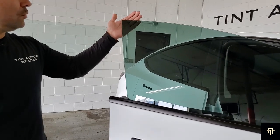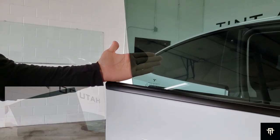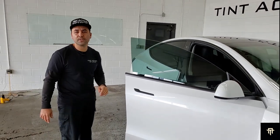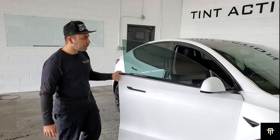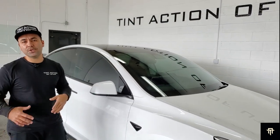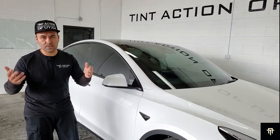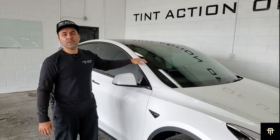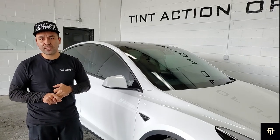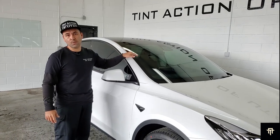Your windows don't have a frame, which means you could actually shave the window tint, giving your windows a factory look. You don't want to have a gap, especially when you have no frame on your glass — so make sure the shop you get it done at can do this for you. The front windshield, we did 70% ceramic. It's not very dark, but it's going to do a lot for you as far as protection and comfort. With a huge front windshield, the dash is black and it's going to absorb a lot of heat. The benefit of window tint on the front windshield is 99% of the UV, above 80% of the infrared heat, and above 45% of the radiant heat — so especially on those long road trips, it's going to make it a lot more comfortable. I highly recommend getting your front windshield tinted.